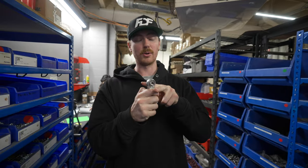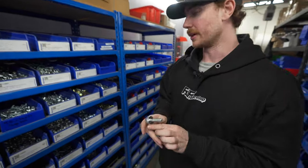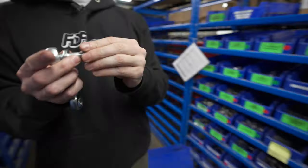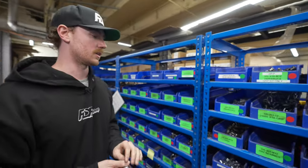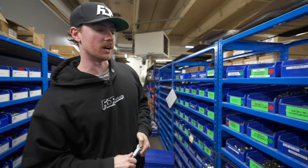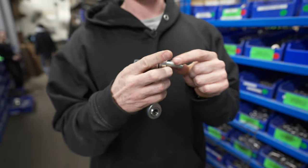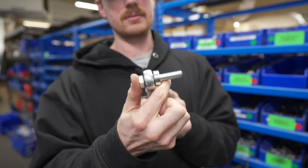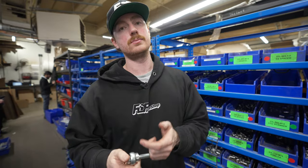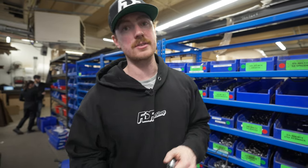In order to get this to connect to things we need bolts and spacers. Typically we'll be grabbing an M12 bolt of some kind and including some washers. We do have some spacers that can go on the side of the heim joint to space it out. The most common ones we use are simple aluminum 8mm thick spacers — these are used on a bunch of our kits. We also send them with our sway bar link kits because you need a spacer to get the body of the heim joint away from the blade of the sway bar. So that's essentially what a sway bar link kit comes with: bolts, washers, spacers, and nuts.